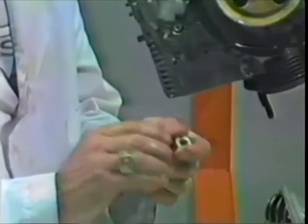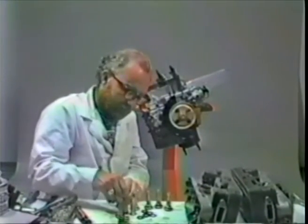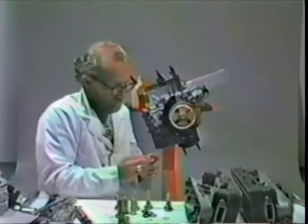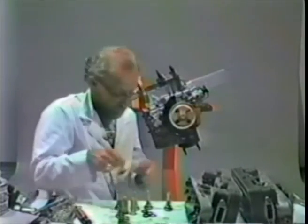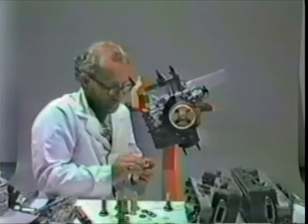Okay, you take the O-ring seals from the top end gasket set, lubricate them, slide them over, get them into the groove of the wide brim head bolt seal, these type here. The middle head bolts do not have a groove on the earlier engines. On the later 912s, there's a groove on them too for somewhat better support of the stud, alignment really of the stud.